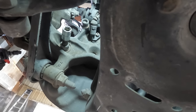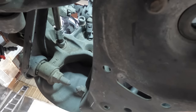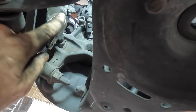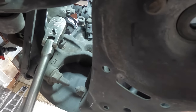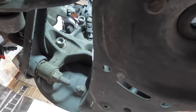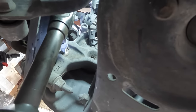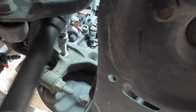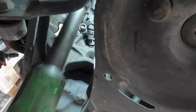Going back down below with the big triple square one more time. We're looking up from under the car at the back side of the brake assembly. These caliper bracket bolts are tight — and then it slipped. The socket wasn't fully seated — hammer it in all the way. That was so bad. Trying again with force to drive it in using an extension. Got it — achieved redemption. That could have been really bad — bad enough to require cutting the bolt out, which would not be cool.